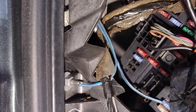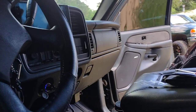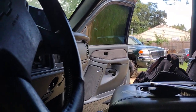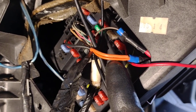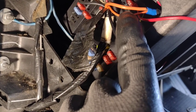This is a rough draft so don't be judging me - crush caps, now it's tied in correctly. You can see I still have my power wire in there because it still has power. The rest of these are speaker wires; I still got the door locks to do. I could not keep riding with roll-up windows - going through a drive-through having to roll the window up manually. So these two orange wires: the thick orange one is tied into a power feed, 12 volts constantly with the key switched off. The small orange one needs to be on a wire that switches off with the key.